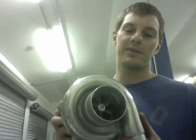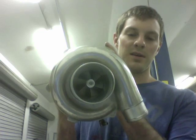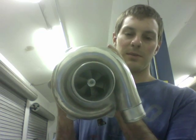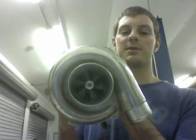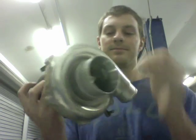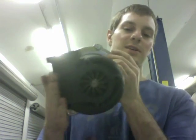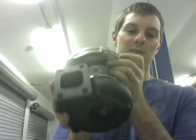Here's one more example that I wanted to show you that is not considered a T3, T4 turbo. The reason why is because the compressor wheel is generally on a turbo that comes with a T3 flange. This compressor wheel is a T04E54 compressor wheel, which is 54 millimeter by 76 millimeter. On the turbine side, we have the same stage three turbine for the T3 exhaust housing.